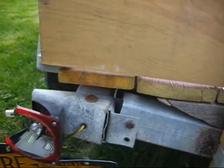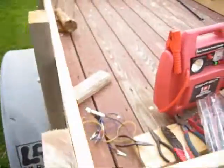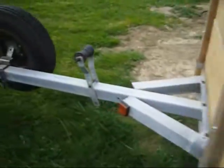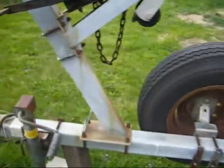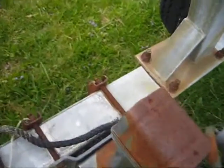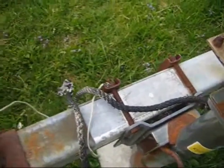And most important of all, you'll need this bucket. This is where the bulk of the work will be done from. Now, before I connect the new light, I'm going to check two things out first. One, that the new light does work, and second, that the wiring in the trailer is okay, that I have continuity going all the way through, that there's no breaks and shorts.